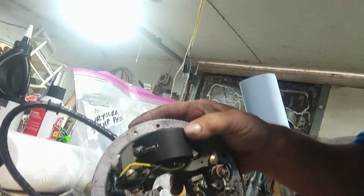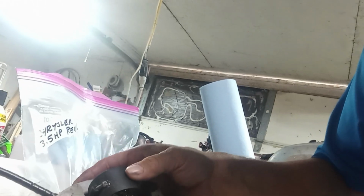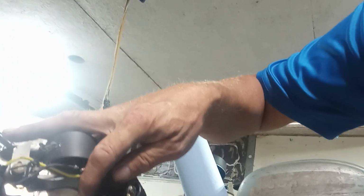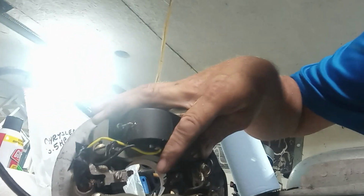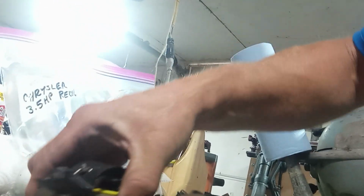Also, this is a used mag plate that I bought, and I started messing around with some coils from these aftermarket coils for Cushman scooter. And the points on a Scott Atwater are the same. And this one was busted. I paid $100 for this, and it's junk. But anyway, I started looking at it, and the points are the same. The coils setup is pretty much the same.